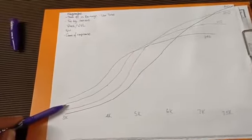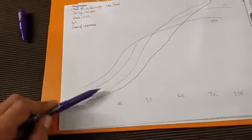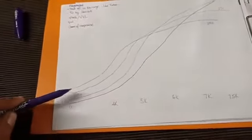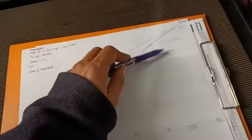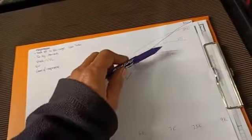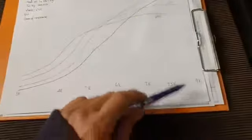So if we were to go to a 272 cam, what will happen is we will lose power in the bottom end, which is now my red curve. So you can see I've lost power there, but then I've gained some power up the top there. So a 272 cam is likely to make more power as long as your turbo and your airflow and your engine support it, but it'll also happen at a higher RPM. So we're looking at much higher RPMs now.